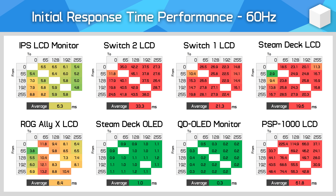The PlayStation Portable has abysmal motion clarity compared to modern displays. It's extremely slow, offering a 62 millisecond average response time with a couple of darker transitions exceeding 100 milliseconds. Some transitions appear as a gradient rather than a sharp change, and this display is simply nowhere near the performance required to support even 30Hz. This is LCD performance from 2004 — clearly terrible compared to where the best screens are today.